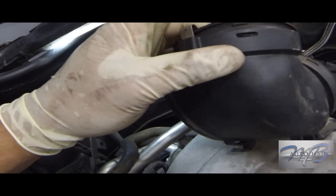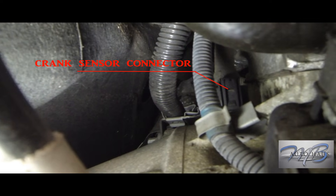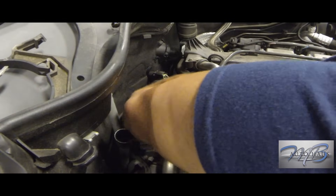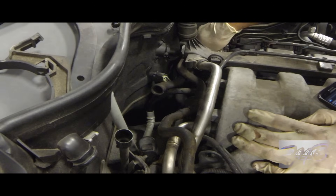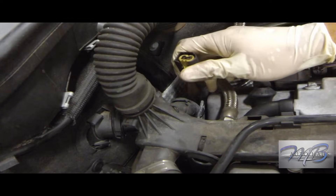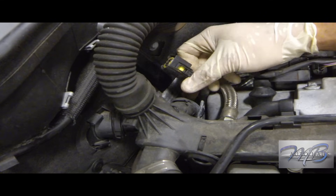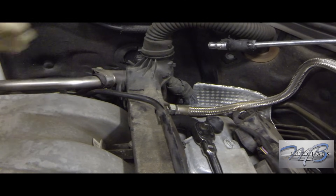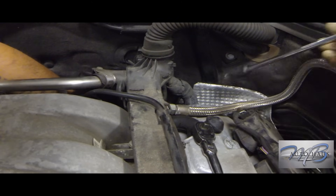Take a quick look at the gaskets to see how they fit in place — there are little holes they fit into. Next, you'll be looking at the connector for the crank sensor itself. The crank sensor sits on the driver's side of the motor, right before it connects to the transmission. I've taken the connector out — there's just a tab. You might need needle-nose pliers, but this one came off fairly easy.